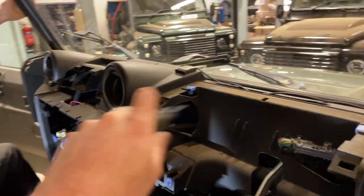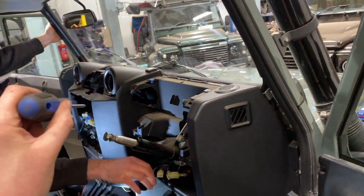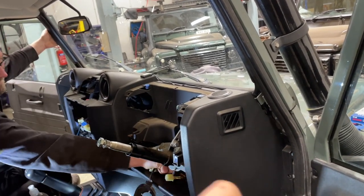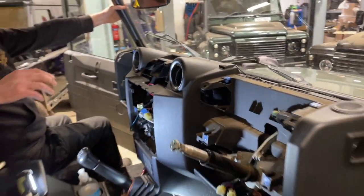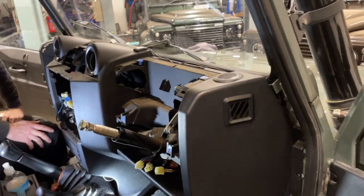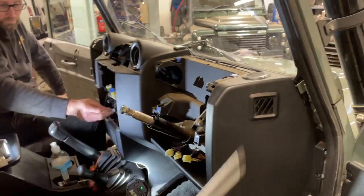And then we'll be presented with all the heater tubes, which every single one has to come off, and then we can basically get to the wiper motor itself, remove the motor, each tube, and the actual worm gear springy, what's it called, Leon? The spring thing that goes in, the rack tube. I don't know, you're correct, it's just cable. The cable, that's it, that operates the worm gears on the spindles. Take the spindles off, and then basically reassemble with all new bits, new grease, and it should be good to go. But let's find the problem first and get this dash out.